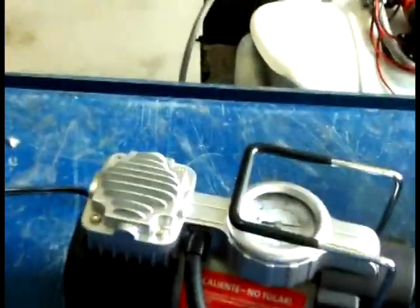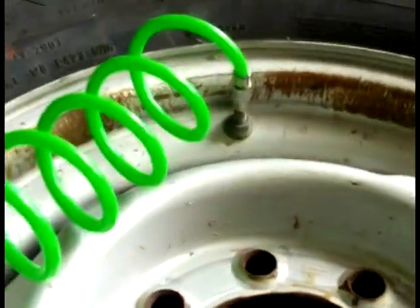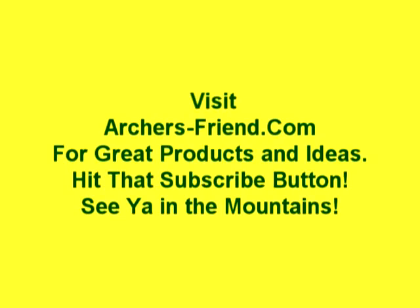We're back — one more quick shot. Time is up for the second 10-minute run, so it's now 20 total minutes. The gauge says 70, and it struggled the last two or three pounds. I'm going to cut it off. The hose is hot again as usual. I also noticed on the box it says heavy-duty 4x4, RV, SUV, and truck — and they lied. It won't work for that; it's just not going to do the job. With a good quality Milton gauge, we look like we got about 64 pounds. So the built-in gauge reads high. Hope you enjoyed that — maybe you can make an intelligent decision on what to buy. See you in the mountains. Hit that subscribe button.